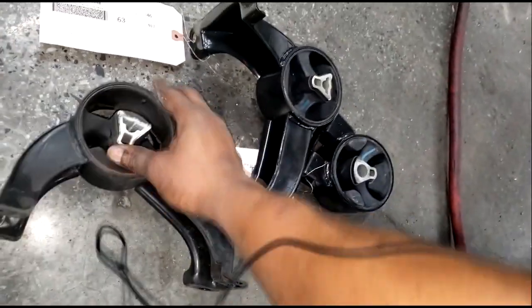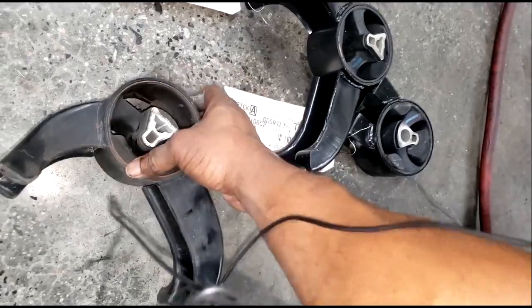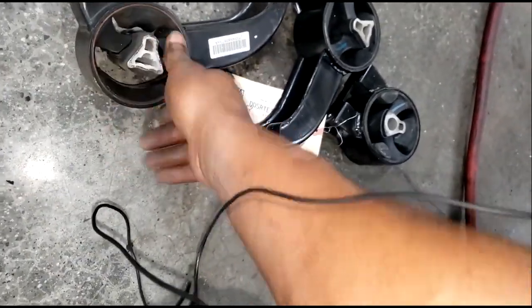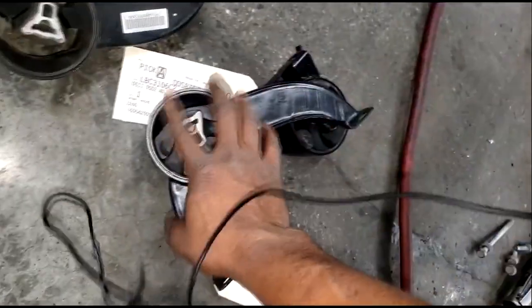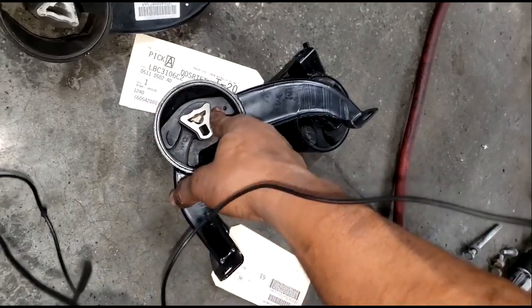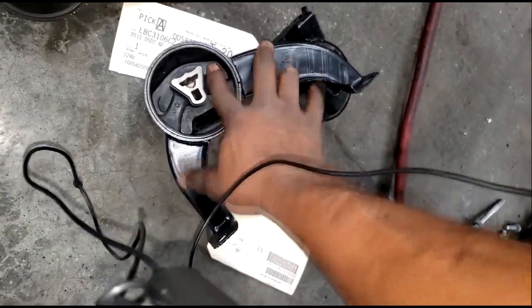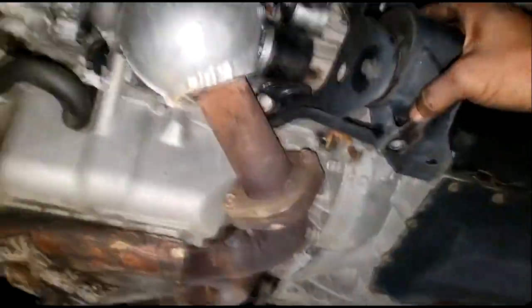These are the last two I'm replacing. When you put it in gear, this is what was causing the bump and jerk. That is bad. A lot of guys try to press out the old bushing and press in a new one, but it's much cheaper and easier to just replace the whole mount. Like we talked about earlier, these don't have to be OEM — it's about the quality of the bushing. I'd do OEM if available, but aftermarket engine support mounts work fine too. I'll finish the rest off camera. Thanks for watching, come and subscribe, and I'll see you on the next video.